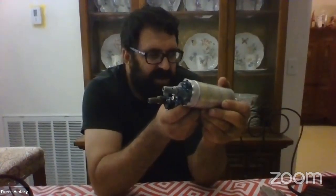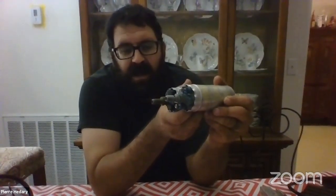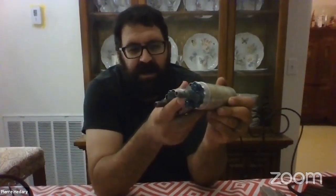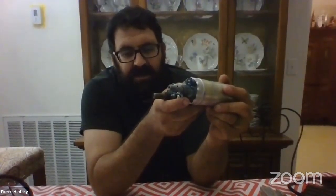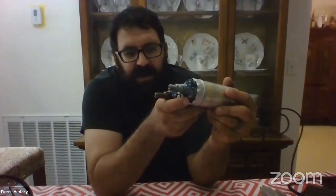The 260E also used one fuel pump, but all V8 cars and later versions of the 300E use dual fuel pumps. If one fuel pump goes down, the system will not work right — one failing pump creates an obstruction in fuel flow because each pump has a check valve at the end. Both pumps must be working for the car to function. The car may idle roughly or die, depending on which pump fails and whether there's enough pressure to pop the check valves open.